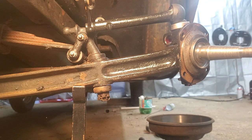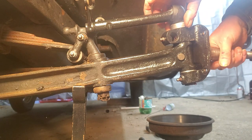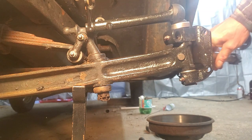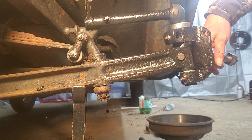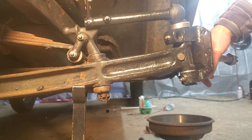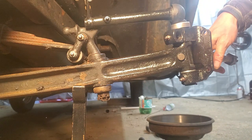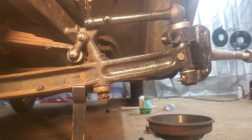Okay, well it feels good. When I pull up on it that top bearing won't turn — there's plenty of space in there. I was gonna leave this car pretty much the way it was, not cleaning anything up, leaving it greasy grimy underneath, but after I had it apart I couldn't do it. So I painted just the end here — after I get the car outside I'll do the rest of it. I got the backing plates over there drying now, and I really can't go any further with this because I'm waiting for the tie rod ball joints. I got a lot of cleaning up to do. I think it's good to go, so now I'm on to something else. Hope you got something out of this video or at least it was entertaining. I'll be into the brakes — that'll be another whole video.